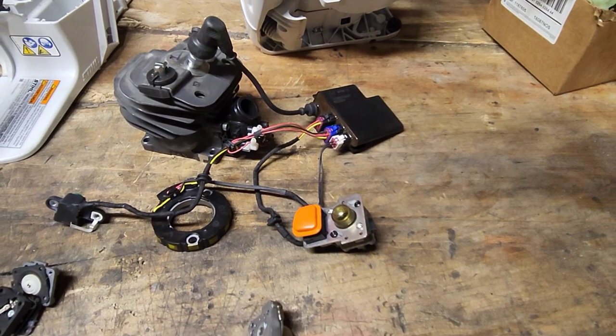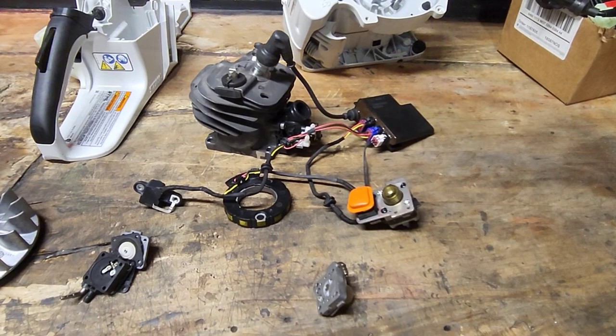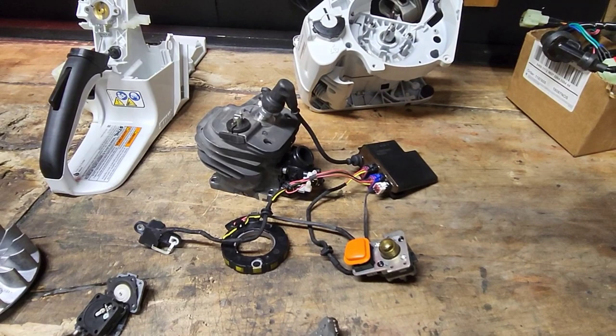The spark, the fuel delivery, and all that stuff is mapped the entire time this thing is running. That's why they accelerate so fast. That's why they run so good. It's also another reason why you don't want to just shut a 500i off when you're at full chat. You've just been beating the hell out of it, and just shut it off when it's at basically wound tight. That's what gives people the hot start issues.